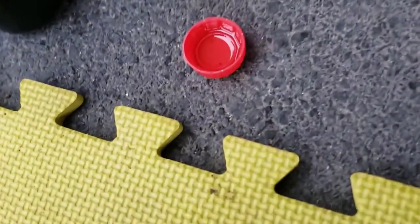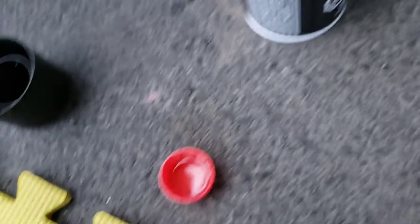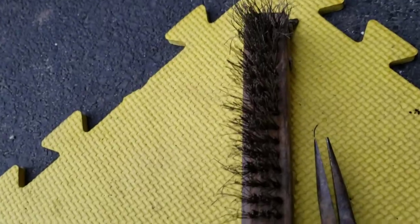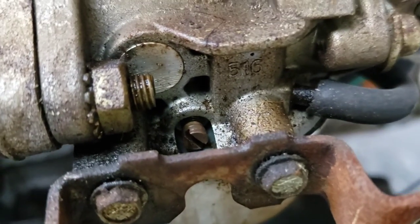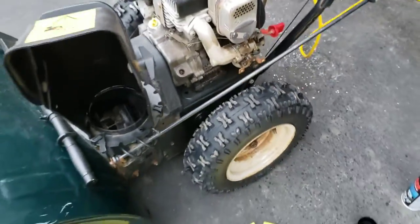Okay, so positive news here. As I said, I was going to use the pop cap, and I filled that up and put the screw in there. The screw's not in there now. It's back in the snowblower. But I put it in the cap, and I sprayed enough of this stuff in there to submerge it fully after I had gouged her out. I ran some of those wires through the holes, and I put the screw back in. You can see it there. One trick was to use some needle nose pliers to get it in there, and then come behind it with the screwdriver so it wouldn't drop on the ground. You want to try and keep it clean, right? That's the whole point of soaking in that stuff. And I just tried it out, and I think she's fixed. So we'll give you a little demo here.